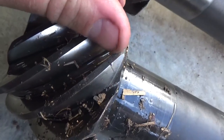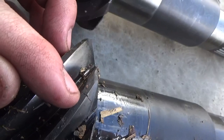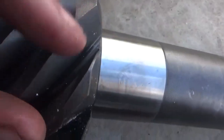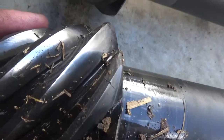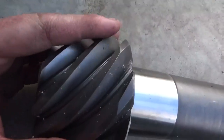There are two different styles of pinions in USA Standard. Notice where this gear is cracked — right here. Notice the gear thickness as it goes out. Now, USA Standard — check it out. Look how much thicker that is right there. This is an old design or an updated new design, one of the two.